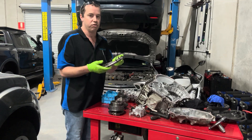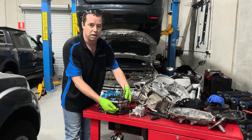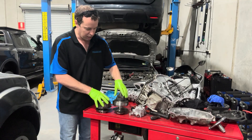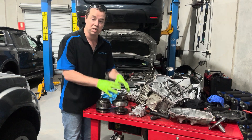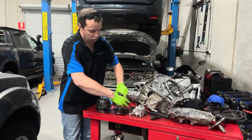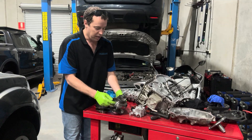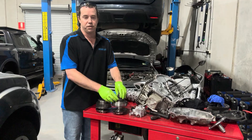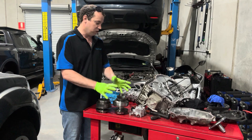The belt sits between two pulleys on cones and runs up and down them, working on oil pressure — the oil pressure keeps the belt on and drives the pulleys. These pulleys have inherent problems too: inside there's a piston ring that slides up and down a bore, and those rings do break. Additionally, the pulleys sit on a keyway on the main shaft — that keyway wears, the balls roll out and it fails. That's when you get the tunk, tunk, tunk noise from the transmission. When we rebuild them we put in a brand new pulley set, or if reconditioning a pulley set, we use a roll pin rather than the balls as they don't seem to wear as much.